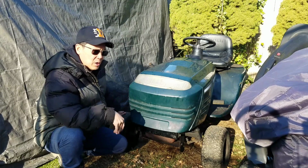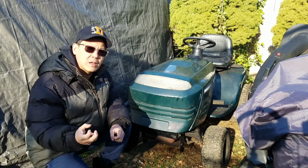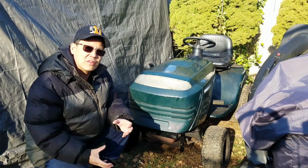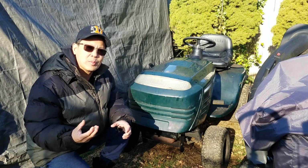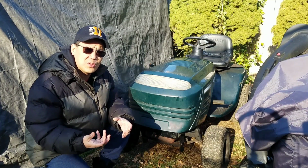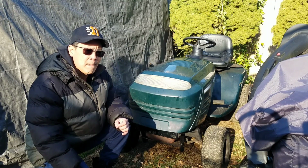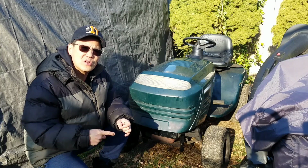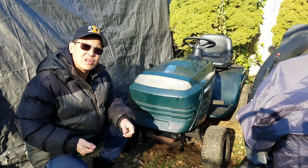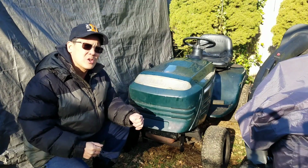And while it runs pretty well, it's got oil encased all around it. When I first removed the double stack pulley, just before I put on the bigger pulley, I noticed that there was a lot of oil on the double stack pulley. So I had initially said that it's probably the crank seal leaking. But actually, when I looked at the double stack pulley, the top pulley, which is right underneath the crank seal, is dry. It was the bottom mower deck pulley that had a lot of oil in it. So I think it's just like the sump gasket was worn or something. As you also know, I went around and hand tightened all the sump bolts as well as the rear access cover bolts, and I could turn each between a quarter turn to a half a turn. So maybe I fixed it.